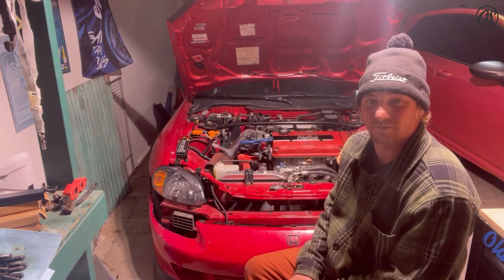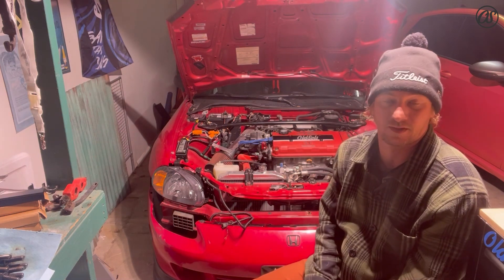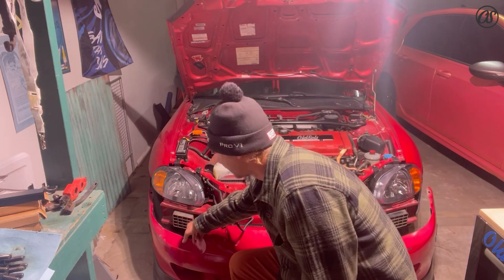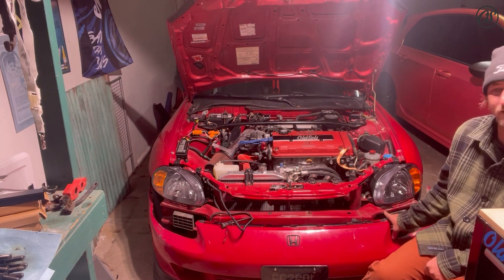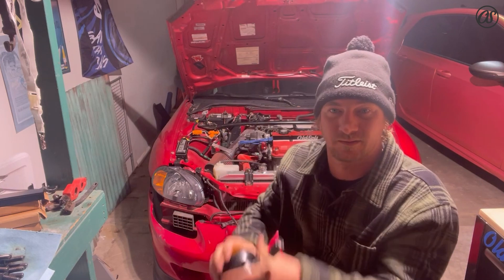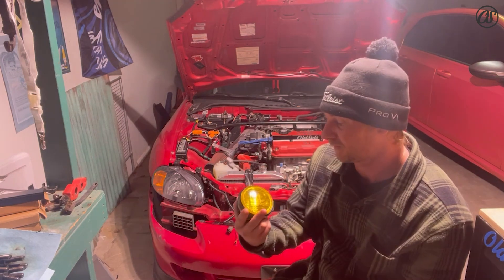What's the easiest most plug-and-play setup once I get these brackets into the bumper? Essentially your fog lights are gonna land just inside those black pieces on either side. The fog lights and harness have about six to eight inches of lead. Going to tidy this up, get it strapped, hang it down in that area, hook up the ground, zip tie it all up, and have it ready for the fog lights.